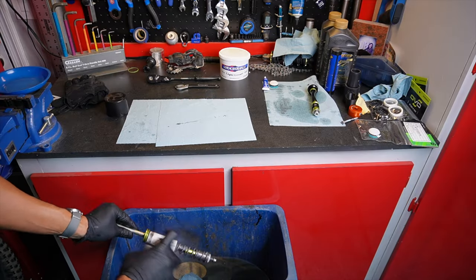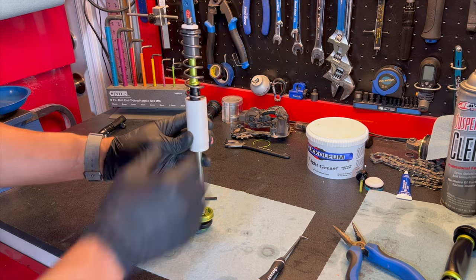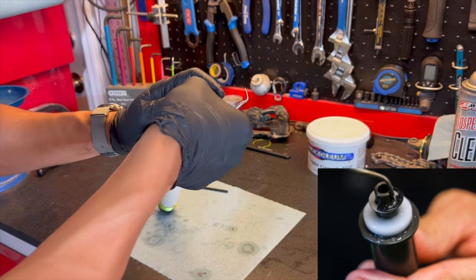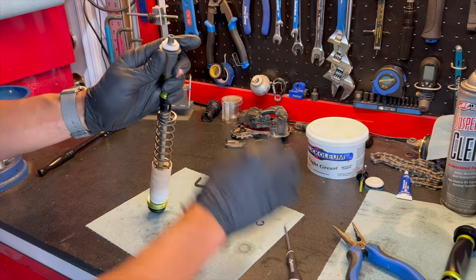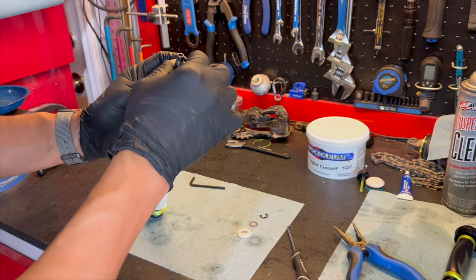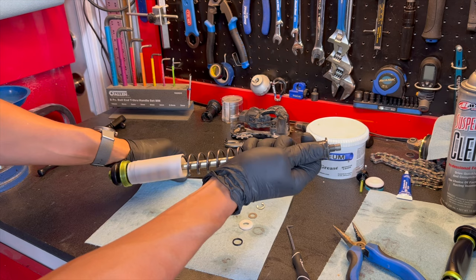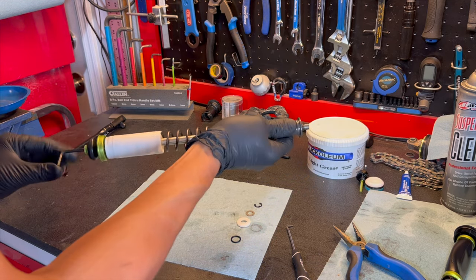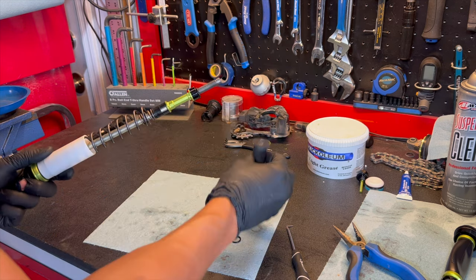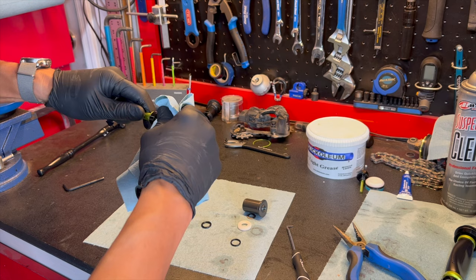Now grab the OTT assembly, clean it with suspension cleaner and shop towels. Place it in the correct orientation and pull downward on the spring to dislodge it from the barrel. Grab the black C-clip on top and use a pick to remove it, then remove the metal washer, the plastic washer — keeping everything in the same orientation for easier reinstall — and then set aside the top-of-barrel O-ring. Now grip the barrel end, insert a 4 millimeter Allen key all the way in, and turn counter-clockwise until the barrel comes off. Make sure you turn the Allen key, not the barrel. Once off, remove the inner barrel O-ring — it may be stuck inside the barrel.